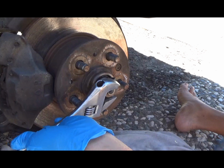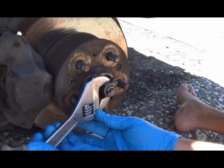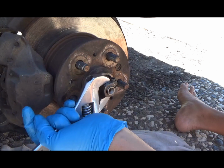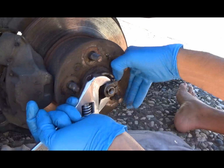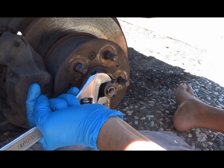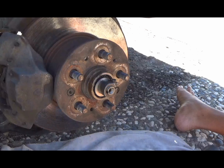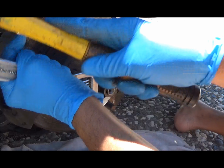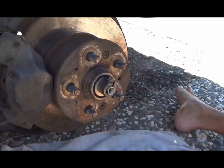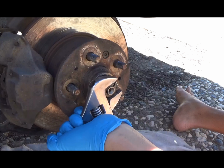Maybe I'll do like we do at work, whereas when we change the tires on the airplane, similar deal, it has a single nut that holds the tire on, and so we tighten it really, really high, 300 inch-pounds to be exact, 350 I think. Then we break the nut loose again, and we tighten it to a smaller final torque. So, I don't know if that helps out here, but it sure seems like it makes sense.